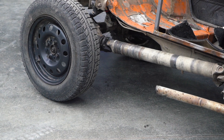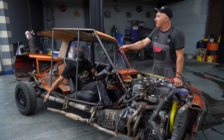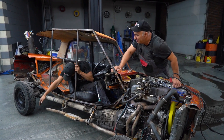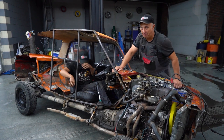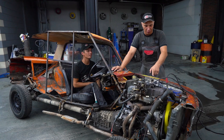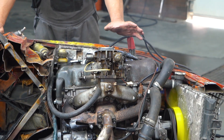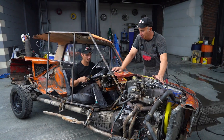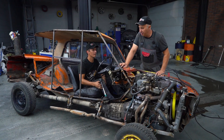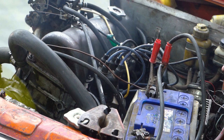It started. Oh, you're immediately checking the exhaust? Take a look at that — that is some severe blow-by. Look at the smoke coming from the breather tube — that is very bad. It's a powerful stream. Shut it off.